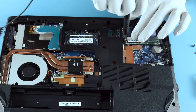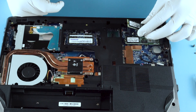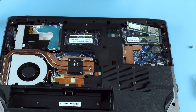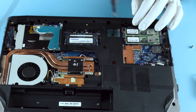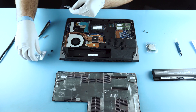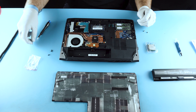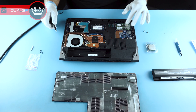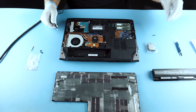They look like standoffs you'd use for a motherboard installation. Are the shorter ones typically less capacity? Not necessarily — they just don't really make them in standard form factors anymore. Generally speaking, everything is 2280, probably 95% of the market or more. The shorter ones aren't more expensive anymore because no one buys them. You'll only really be able to get SATA M.2s in those smaller form factors, not NVMe. If you don't want to go NVMe, you might find a shorter one that's cheaper.